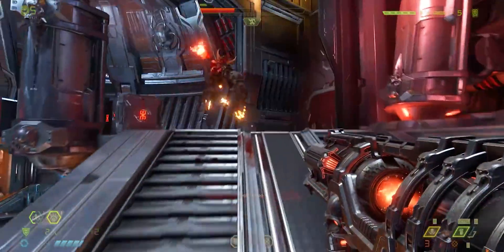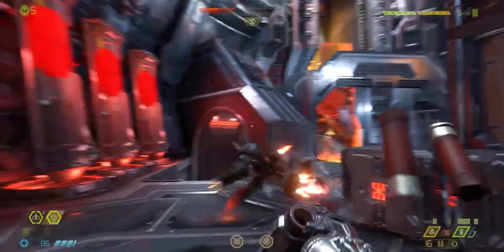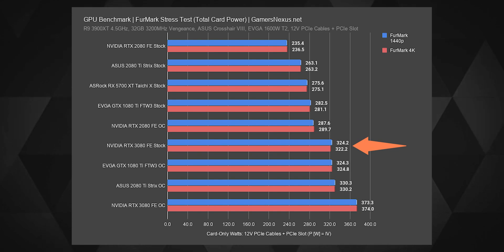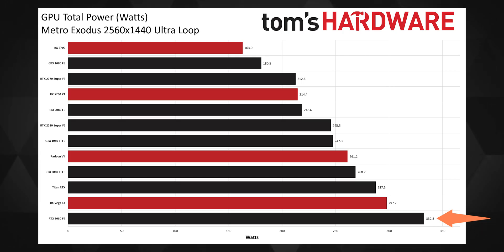Clearly, a good 650W PSU can run your RTX 3080 without any issue at stock settings. But there was an instance where, during a specific boss stage in one of my Doom Eternal gameplays, the game shut off twice, and only on the third attempt could I clear it. That could be because the card tried to pull more power than the PSU could supply at that moment, or it could just be a game bug. Since the RTX 3080 has tendencies to spike above its permissible TDP — as reviewers like Steve from GamersNexus have noted — it's probably safer to invest in a higher-rated PSU, though you don't need to panic until you find one at an acceptable price.